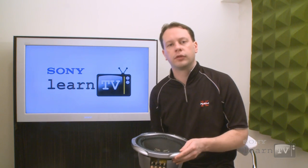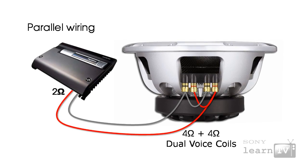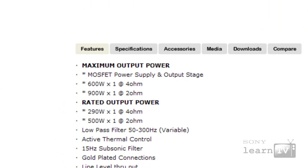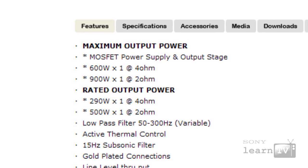The second, and probably the most popular way of using dual voice coil subwoofers, is to run them in parallel. By running them in parallel, what you do is present the amplifier with a lower impedance — that's the ohm rating that you see on some amplifiers. On most car audio amplifiers, as you reduce that ohm rating from, for example, four ohms to two ohms, the power actually goes up. The concept of impedance in a car audio circuit is very similar to that of resistance in your home wiring.